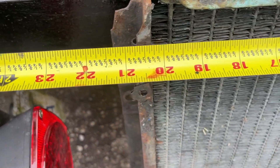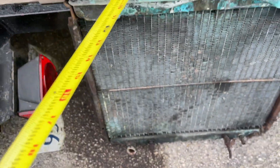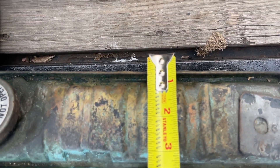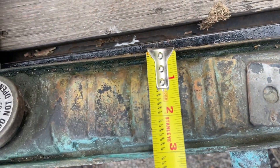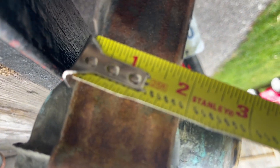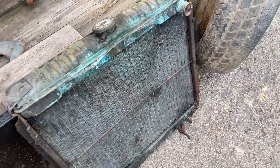The core is 20¼ inches. The top of this one is about 3¼ inches wide, and the side is 1⅛ inch. So the V8 radiator — the one that came in the V8 — is wider than this, but this will work.